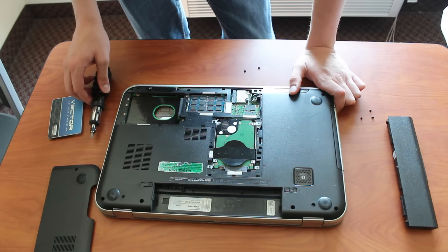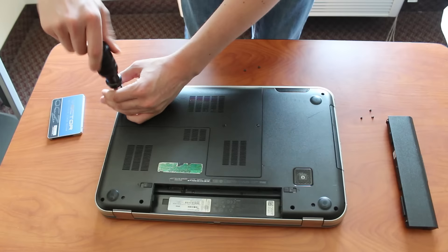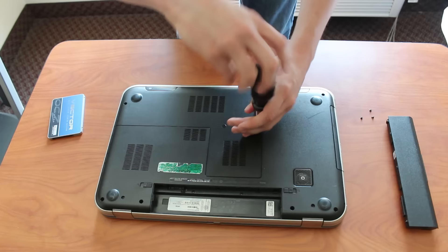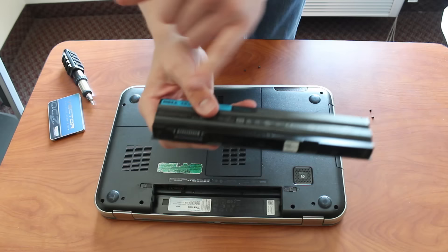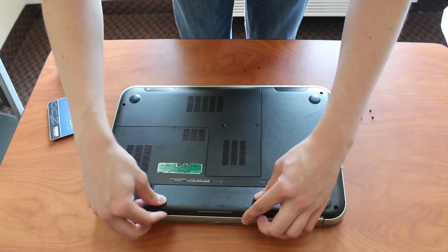Once you have the new hard drive in, you can put the cover back on. I'm going to tighten these down a little bit. I have a ratcheting screwdriver, so it automatically doesn't tighten too much — you can see right now it's ratcheting and it's not going to tighten anymore because it's plenty of torque. Do the same on the other side. Then the very last thing: put your battery back in. Make sure to line up the slots with the metal pieces sticking out — that's usually what you want to stick in first, and then you pop it in.